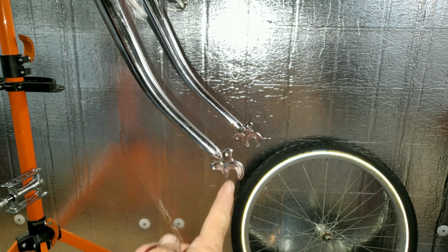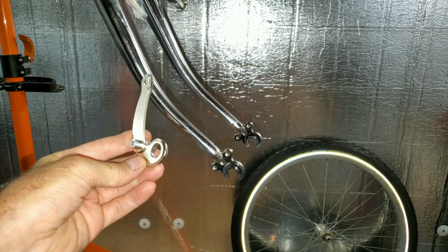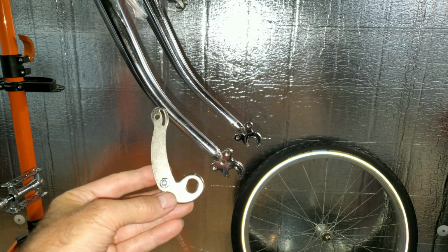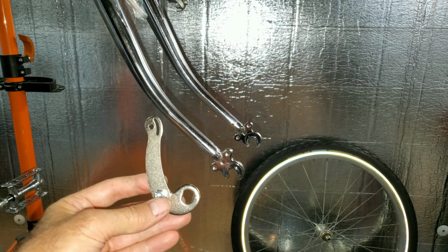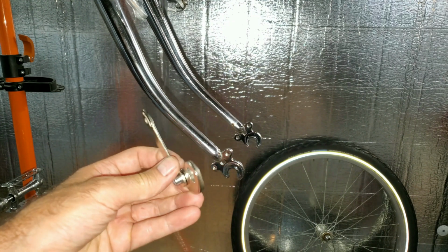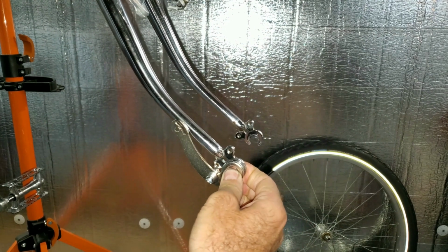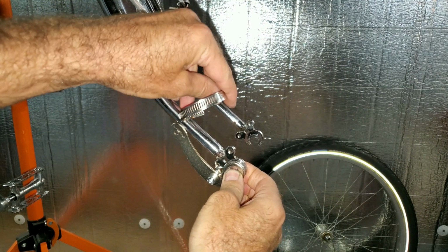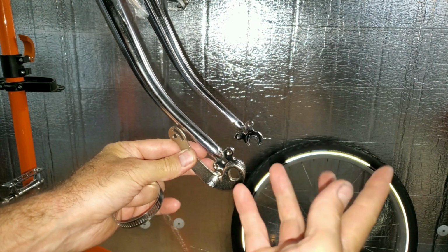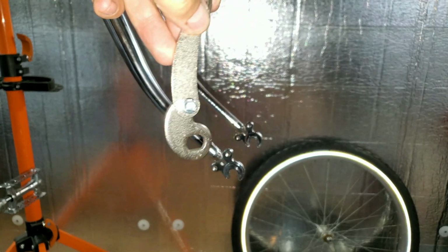So to keep people from dying from this system, there's people that designed this goofy little torque arm thing here. That's what they call it. And apparently the people that designed this, the Chinese, pretty much stole their intellectual property, and they make a bunch of these. And the people that invented this, they no longer make this anymore. It goes on here like this, and then you put a hose clamp around here, and then it's supposed to keep the axle from spinning and flying out, which is kind of goofy. I don't know. I think this is about the cheesiest thing ever.